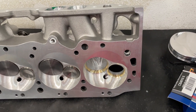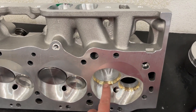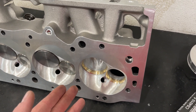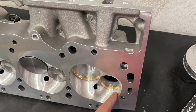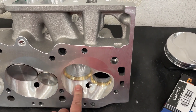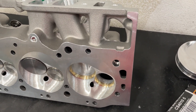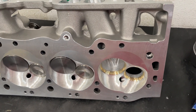There are some options done on this head that will make it better. The head comes with a 2.400 intake and 1.800 exhaust valve, which is much smaller than what you're used to — usually a big block gets a 2.300 and a 1.880. This exhaust valve is a lot smaller and the intake valve is quite a bit bigger. They flow about 500 CFM peak, but at low lift — at 0.400 it flows 330, and at 0.500 it flows 400. It's a really, really good head.